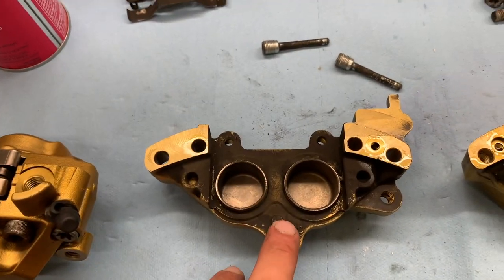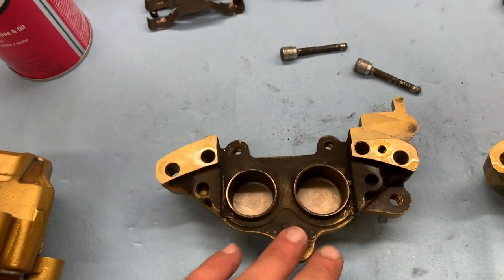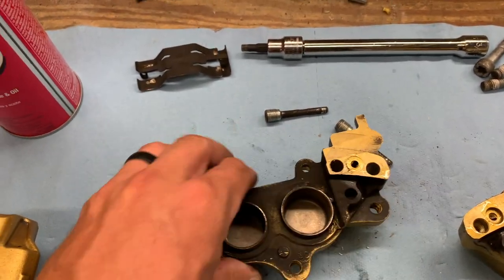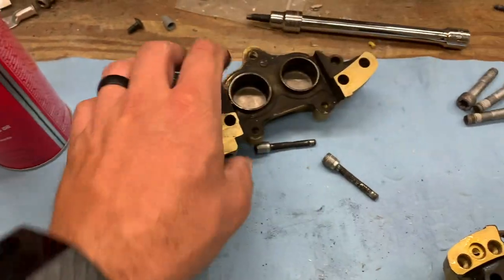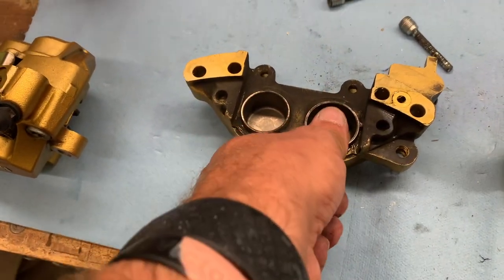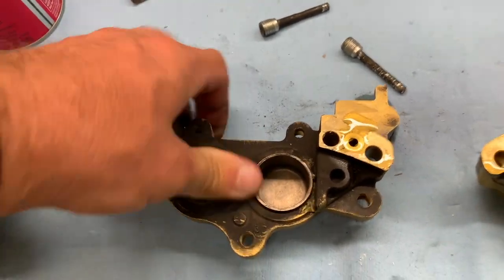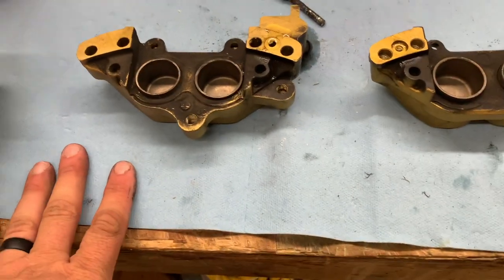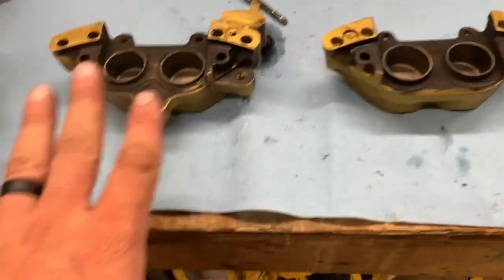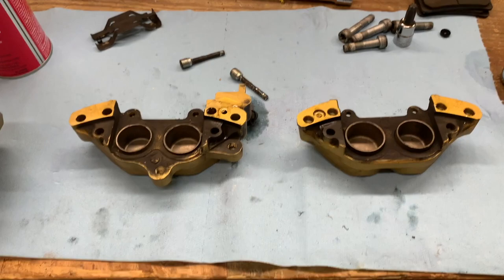The front side of the caliper is a little bit more difficult for taking the cups out because you have more ports to cover up. I like to leave the bleed screw in — that's just one less port to cover. You've got a port here, a port here, and another one on the other side. You've got to cover all of them except for one with your finger and keep pressure on the pistons. I'll push these pistons down to work them through the range of motion before making the final push with air pressure.